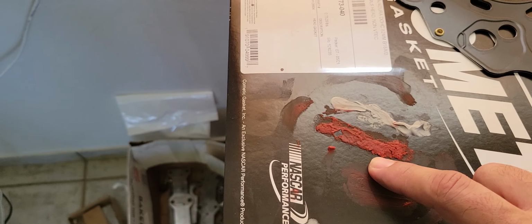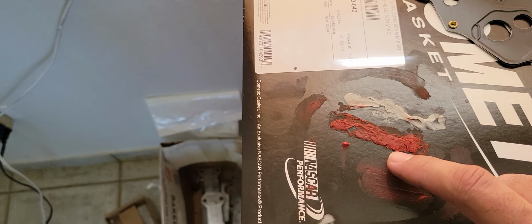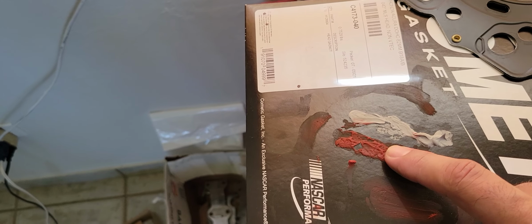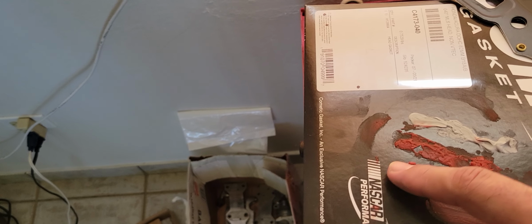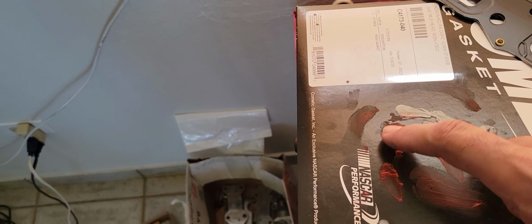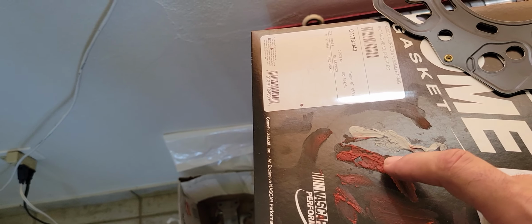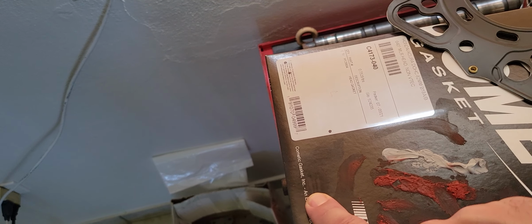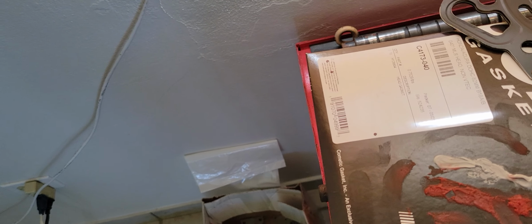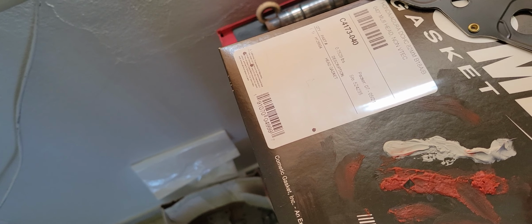First, this is a high-temp silicone. I don't like it. These two layers have been here more than 24 hours, and this is why I don't like it. Look at this. It's like it never dries up. I don't know if this will be activated by heat, maybe from an exhaust manifold, but for this application, that won't work for me. I need this to really stick to the head gasket, the block, and the head.